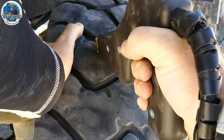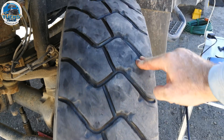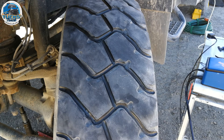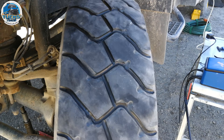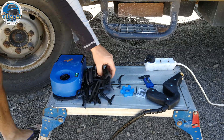That's the tyre finished — all the horizontal and vertical cuts are made. I've done it on the front wheel because with it mounted on the front, the steering turned and wheel jacked up holds the wheel in place while you work on it. In reality though, now I've re-grooved it I will be doing a tyre rotation to the back — I prefer to have my re-grooved tyres on the back from a safety point of view. I've had a tyre blow out on the back in the past and the truck is completely handleable, so I think it's a much safer place rather than having it on the front braking and steering wheel.